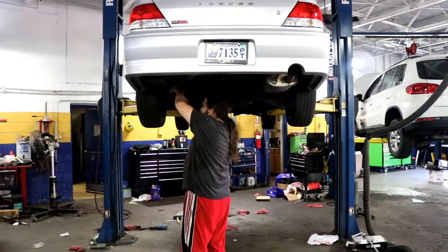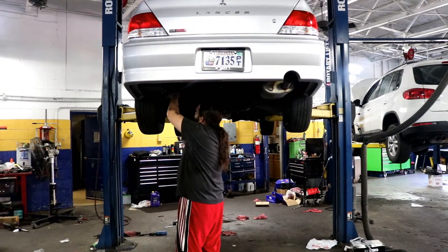We've got all the alignment stuff put in, we just got to get it all finagled and figured out. Now we're getting started on the rear anti-sway bar — this should be good. It's a much bigger bar and I'm hoping it makes a huge difference, especially when it's time to drive on some dirty gravel road. Basically you undo the bolts on the end links and the two mounting bolts on both sides, pull the bar out, then reverse the process to put the new one on.